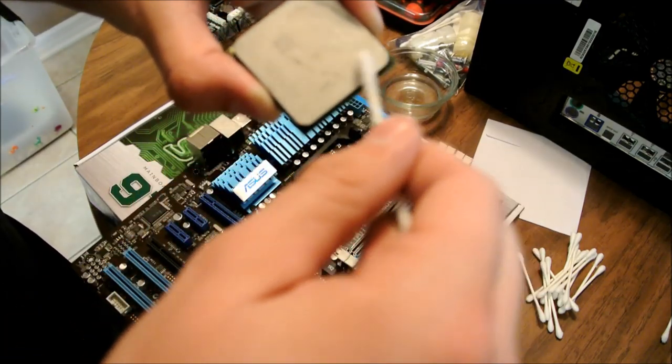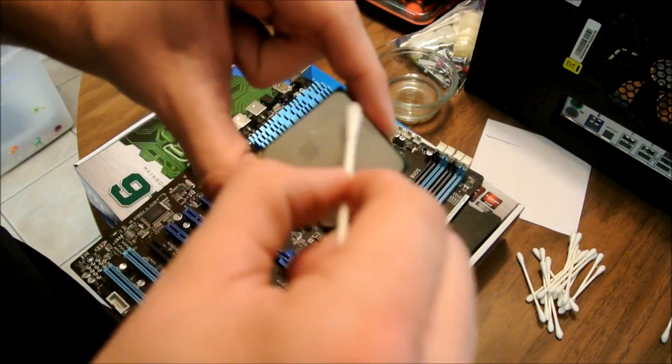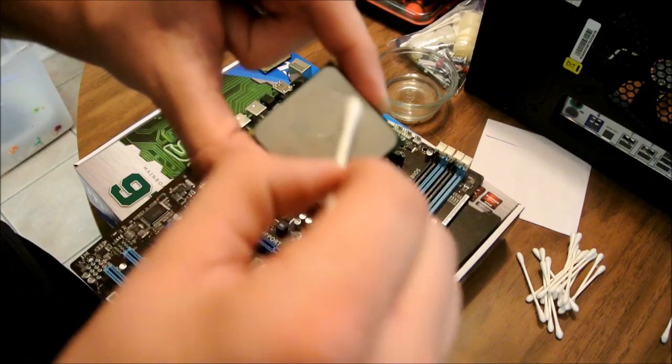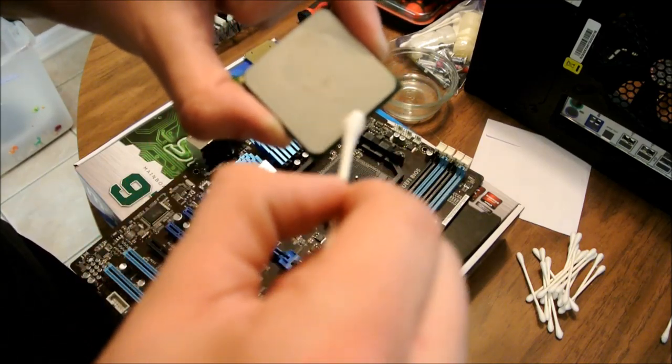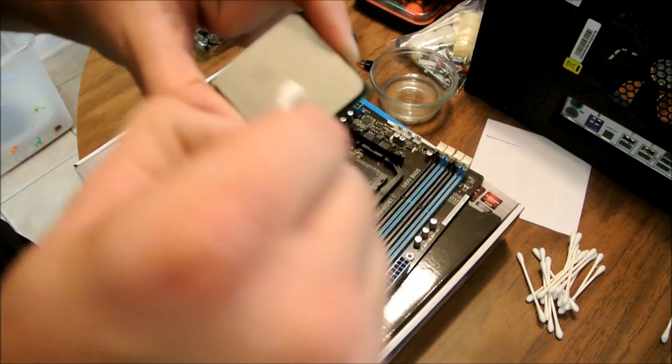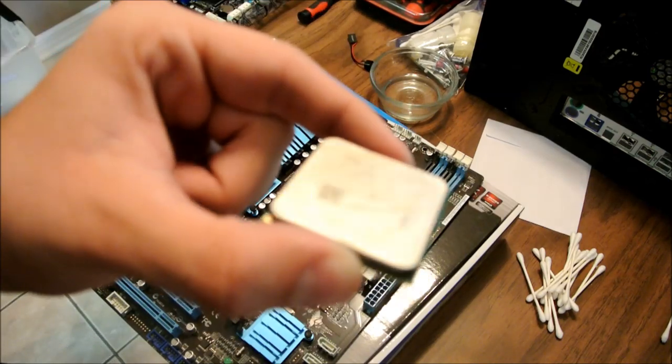It's actually the same thing if you're going to be doing an Xbox Red Ring fix. Same thing: you find the CPU and GPU chipsets in the board itself. Generally, most of the time, the Red Ring of Death is caused by that thermal paste. They use crappy thermal paste when they put it together, and over time it wears down and deteriorates. And that Red Ring is actually the computer either overheating or sensing that it doesn't have that heat sink there.